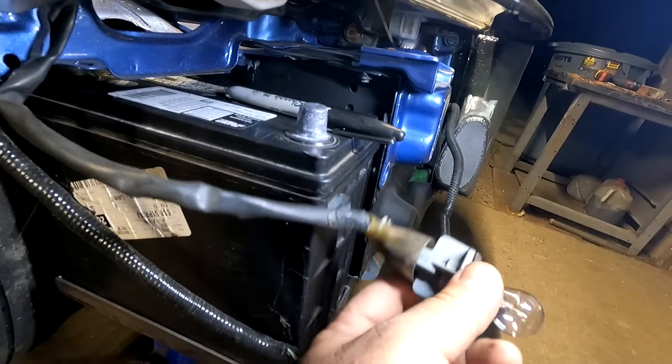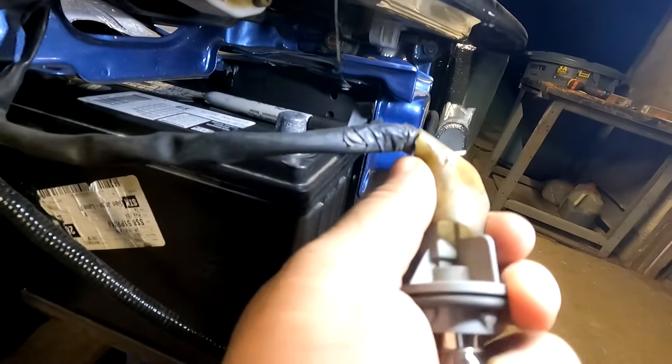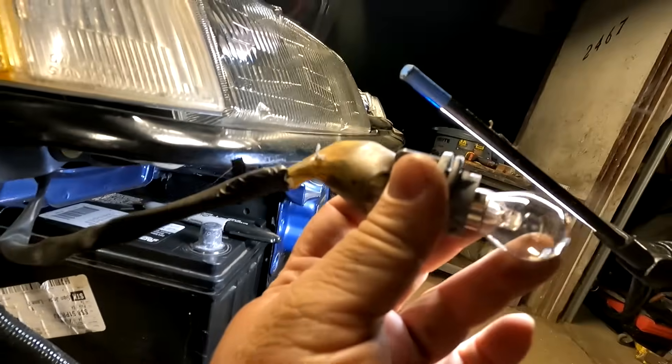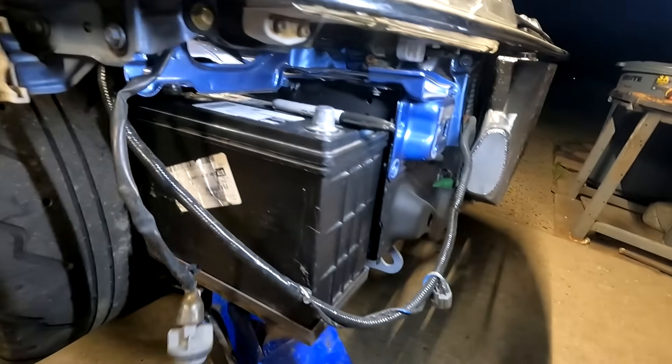On the flipper — the CRX — I did the same thing and it hit right there, but what I did was take off the plug and run spade terminals to make it shorter so it doesn't interfere with the battery once we secure the lamp into the bumper.